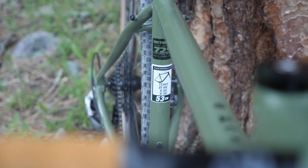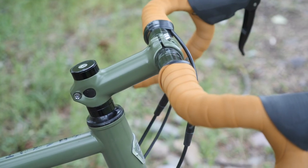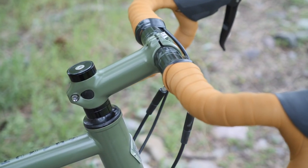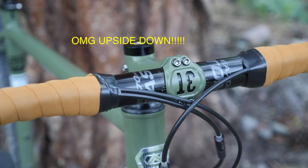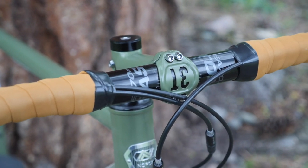So that's what I liked about the bike. What did I not like? Well, I mentioned I love the stem, but it's also a downfall. For some reason, I feel like they spec the stem really long on this bike. So I almost immediately had to swap out the nice custom painted-to-match stem just for a generic black stem, which is a total bummer because it ruined the look of the bike. I feel like the stock positioning they want to put you in is way forward, compared to the current trend in gravel bikes, which is a little bit more upright so you have more control on the downhills and just more comfort overall for longer rides. So the stem — loved it visually, but actually was not a fan riding with it.